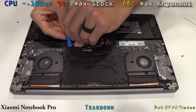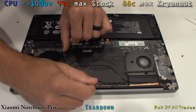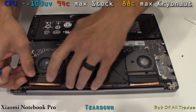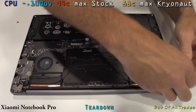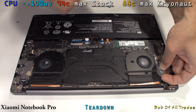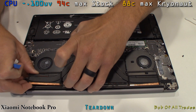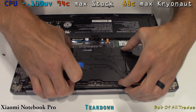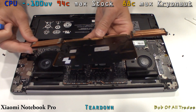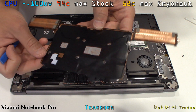The six screws — very tiny — remove those from the heat sink, and then slowly begin to pry around. Something very unique about this heat sink is the outer edges have this flange, and they sit inside of an aluminum groove that is actually attached to the motherboard. Be very careful when putting this back together, but that also means it's going to be nearly impossible to do it incorrectly. There is no need to remove the screws from the fans.